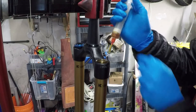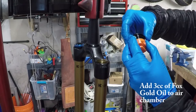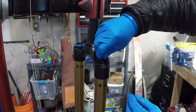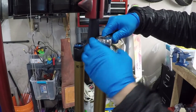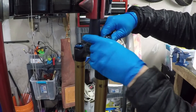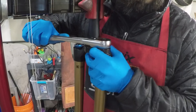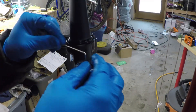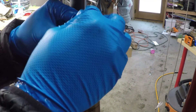Insert a little bit of Fox Gold oil into the air side — we no longer use float fluid; this stuff works really well. Make sure your top cap and volume spacers are clean and spotless when you put them back into the fork. Prep the threads with some dynamic seal grease from RockShox — it's green PTFE grease. Establish your torque and get back to that pressure when you put the top cap back on. For now, don't worry about inflating the fork — that's one of our final steps.